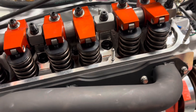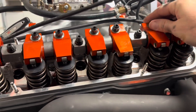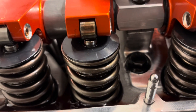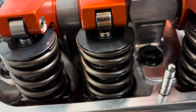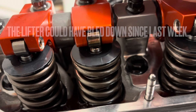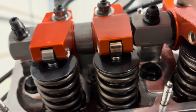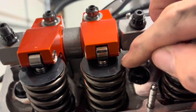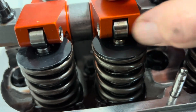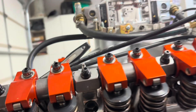I'm on side number two — the even side, passenger side. For the most part everything was looking normal, but this one has a little bit of rock, and you can see a little bit of discoloration on that roller. I'd like to know what's up with that. I'm going to back this thing way off as far as I can, let the rocker down, and try to look at that valve stem tip. The roller rolls — that's not a problem. It just has a little bit of side play. I'm not worried about the side play, but more worried about why it's loose when the rest of them are not.